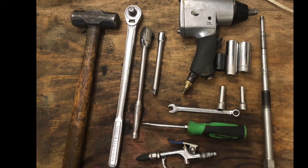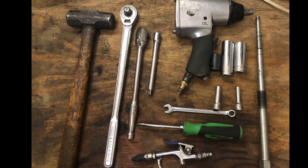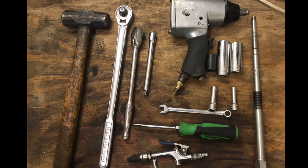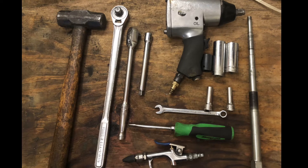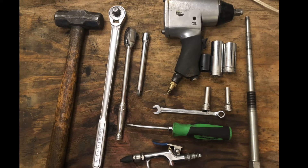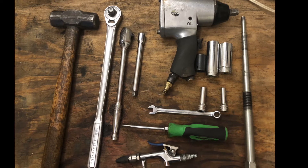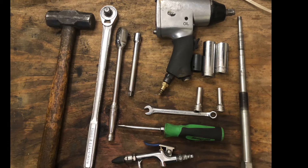We're just playing, guys — don't burn your ride. If all else fails, bring it to us and we'll fix it for you. Here's the actual list of tools you will need: a half-inch drive ratchet, a 3/8-inch drive ratchet, a 6-inch 3/8 drive extension, an 8mm 3/8 drive socket, a 10mm 3/8 drive socket, a 15mm half-inch drive socket, a 21mm half-inch drive socket, a 7/8 half-inch drive socket, a 3/8-inch open-end wrench, a flat screwdriver, a blower for your air hose (optional), a half-inch impact, and the Polaris clutch puller number 2872085.